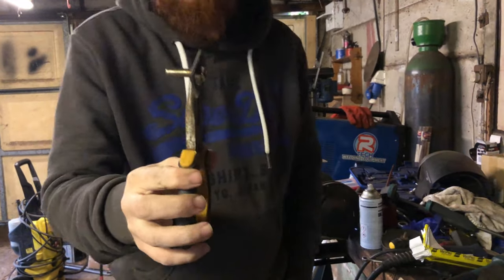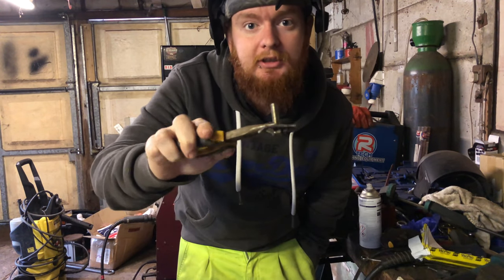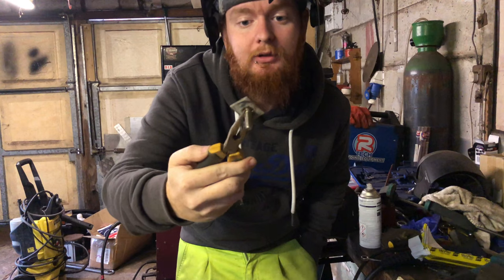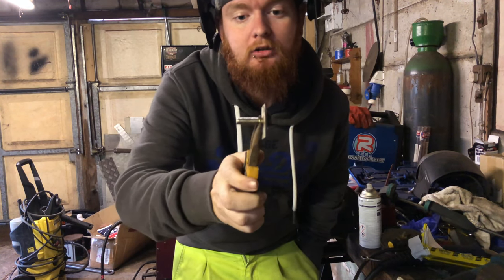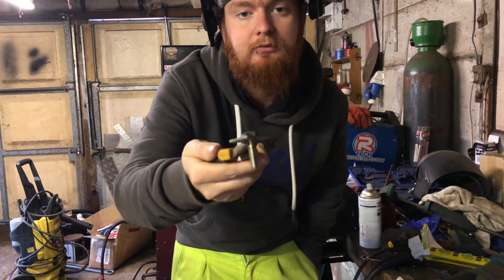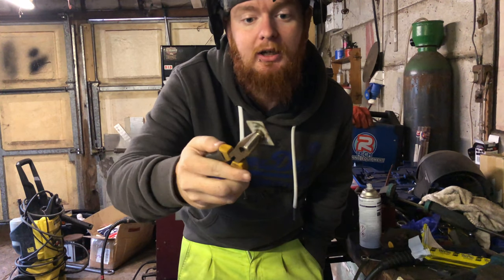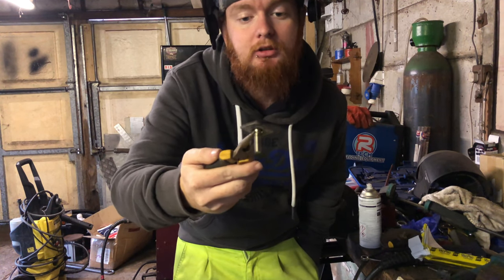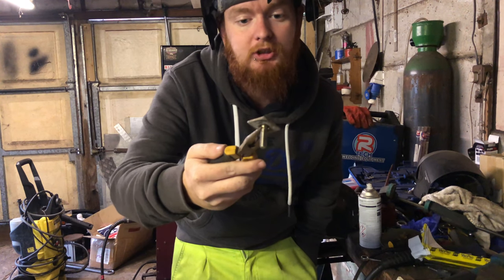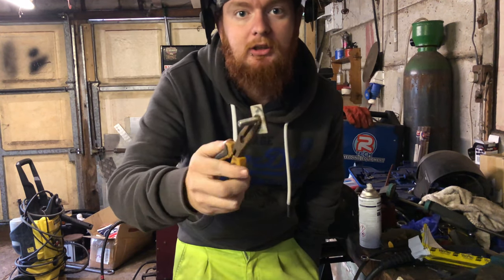These are what's going to hold the roof rack on and enable it to be removed without having to take the ceiling out of the van once it's converted. We've got A2 stainless M8 bolts welded to a reinforcement plate, which will then get welded onto the inside of the roof of the van. That makes it easier to just take the nuts off on the top side of the roof rack so it'll all lift off in case it ever needs to be removed at a later date.